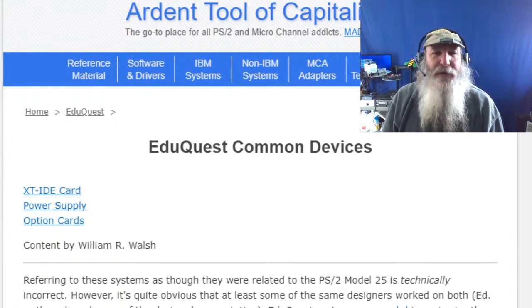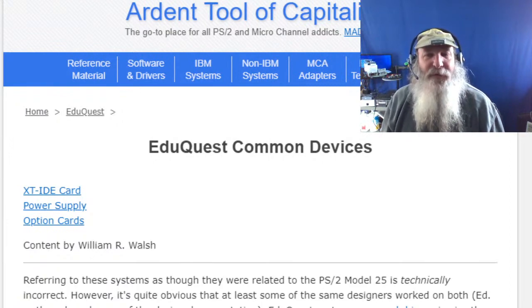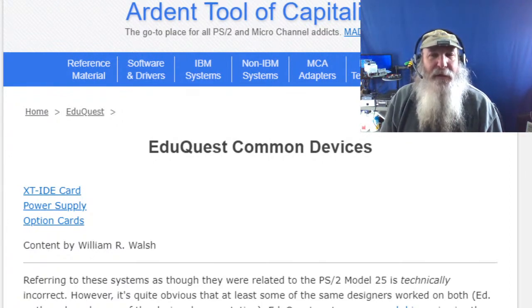And so IBM would release a planar and have a ceramic RAMDAC initially on the board, and later on would convert to a plastic RAMDAC, plastic housed. And you'll even see some planars that, as they transitioned from that, will have clamping diodes that are soldered on the legs of the plastic RAMDAC to basically help it be a little bit better or adapt from the earlier ceramic RAMDAC.